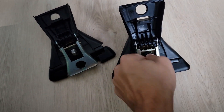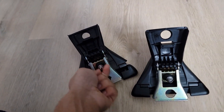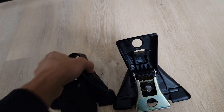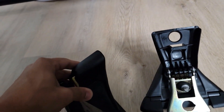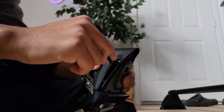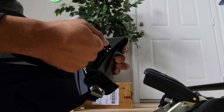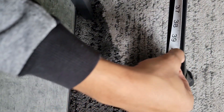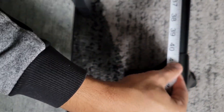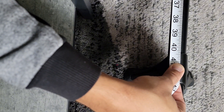The first thing you have to do is loosen these things right here so you're able to slide off the back housing to get to a bolt, so you'll be able to put the bar in. Some people take these all the way off — I realized you don't need to. That's the bolt that we got to get to, and that's what loosens this inside so the bar can go in and have a snug fit. This has to be 40 and 3/8 inches in length — and that's right on the money. I'm happy with that.